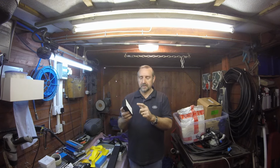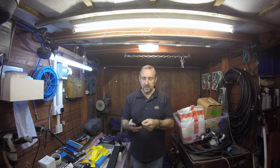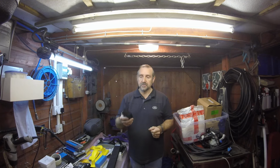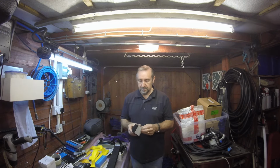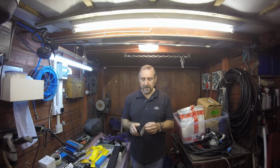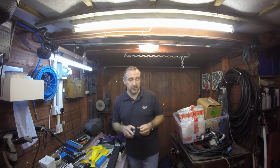It doesn't put that silly a scratch in that you're forever chasing scratch marks by doing stoppering or lots of coats of primer. The downside with lots of coats of primer, yes, you might at the time of painting hide all the scratch marks from your aggressive papers, but maybe 3 months down the line, when that paint has shrunk and cured back, we'll say, those lines can start reading through the surface. So if you don't want to see any marks in your paint 3 months down the line, don't put them there in the first place is the answer.